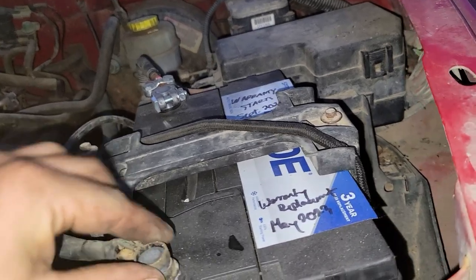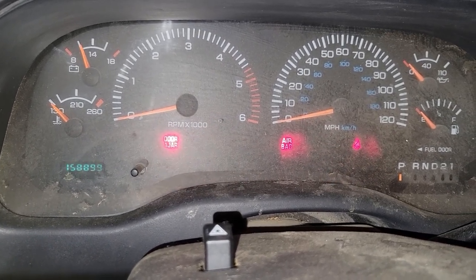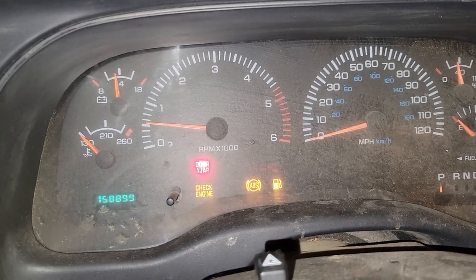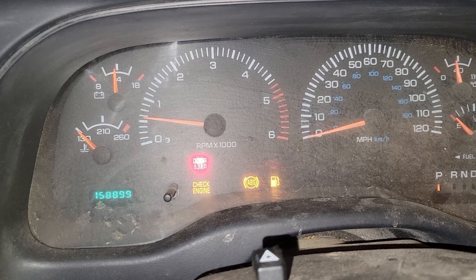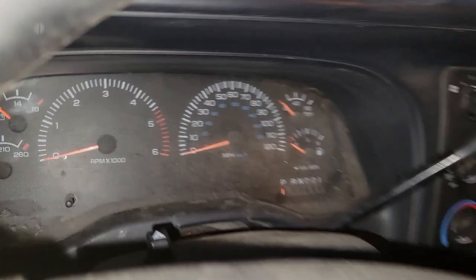To see what I forgot. I think we're ready to hook this battery up. Hopefully it's still got a charge, because I don't know if it does. It must. Cold start. It's been a couple weeks. Oh. That's running on four cylinders right now, because I forgot to plug the plugs in. Also, maybe that muffler isn't bad, and that was the exhaust leak, because it sounds quiet.